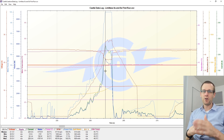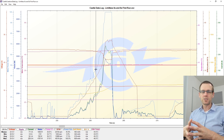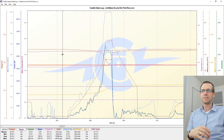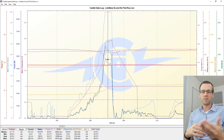If you don't see 100% but you're confident your speed control has been programmed correctly, you may have some sort of delay device on the throttle delaying the throttle signal and not allowing the speed control to hit 100% — in which case you need to adjust that delay. Now I'm always interested in taking a look at voltage and just seeing how it looks for a pass. This is very conservative, our first successful pass, and voltage looks okay — we're seeing an appropriate amount of voltage drop for this specific power system.